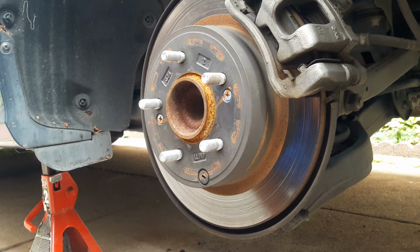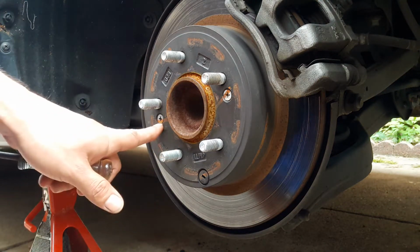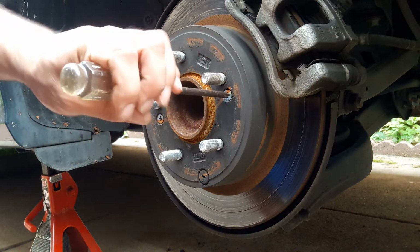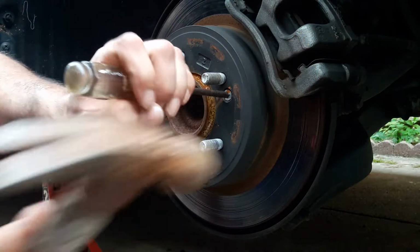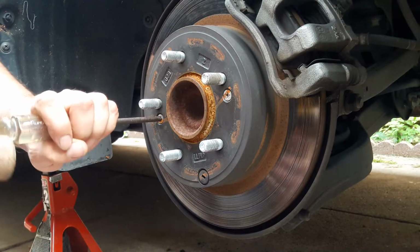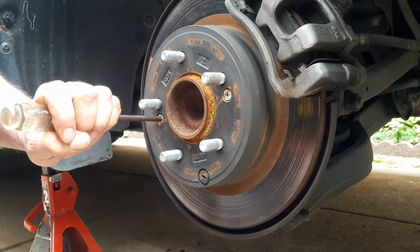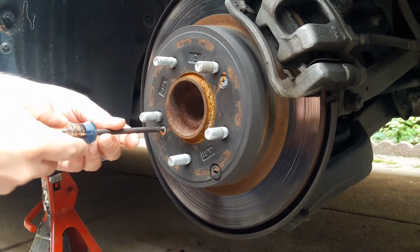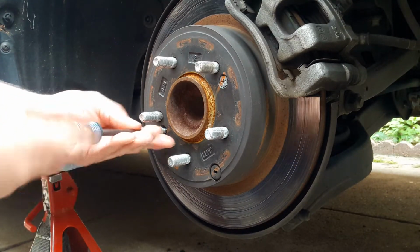So after you lift your car up on jacks and remove the tire, next thing you're going to do, you're going to remove the 2 rotor screws, which are these 2. So you grab a phillips screwdriver, you might get a hammer, that's it.